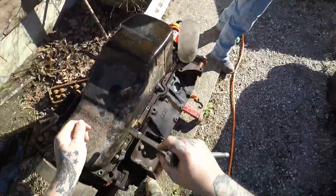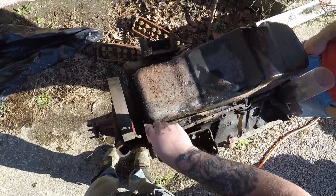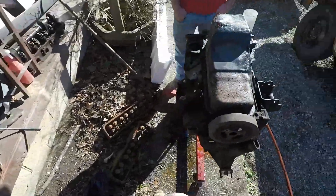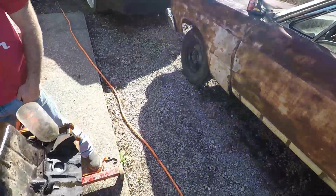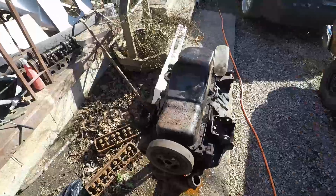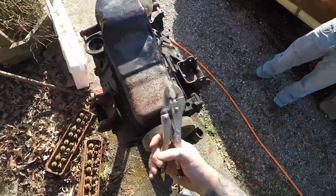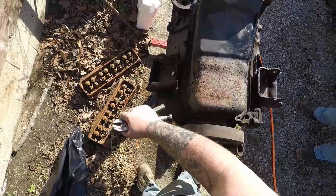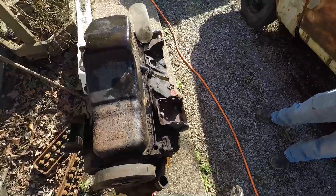I want to put new gaskets in it — new gaskets are about 40 dollars. Once you get all your bolts out, your braces will just pop up. You can hold on to these — they help seal the pan. But if you put an aftermarket pan on it, most people don't reuse them. Aftermarket pans, if they're good quality, are sometimes a little bit thicker. You can just tap on the sides. This pan's rusty — I would replace that. Good old steel pans.